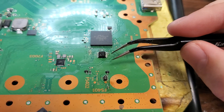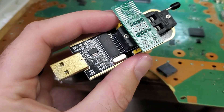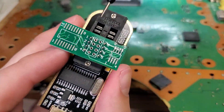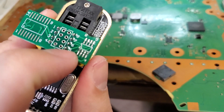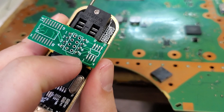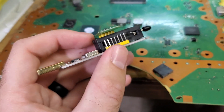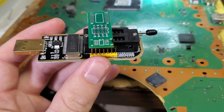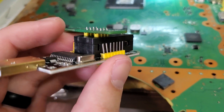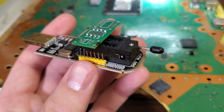Once you take it off, you're going to need to put it on a BIOS reader. This is the little BIOS reader here, and this is why you need to know where pin number one is — that number one right there is where you're going to put pin number one when you go to solder it on. I'll put a link down below where to get this; you can get it on Amazon pretty quickly, and then you'll have to set it up.